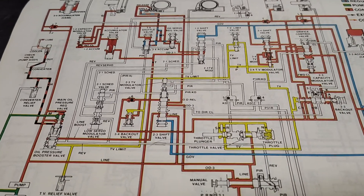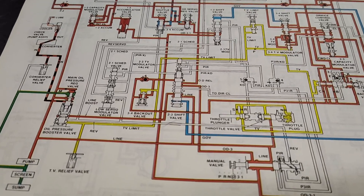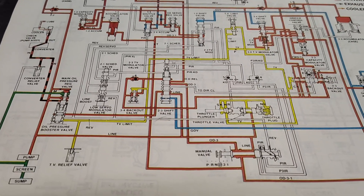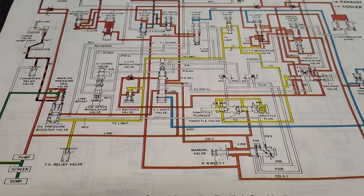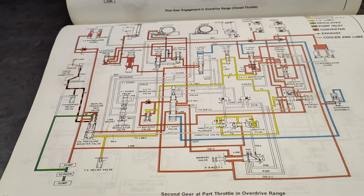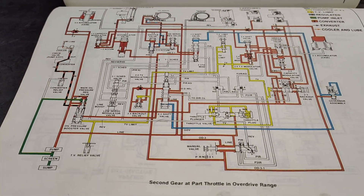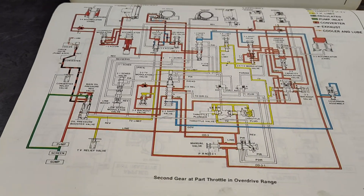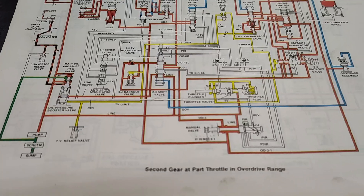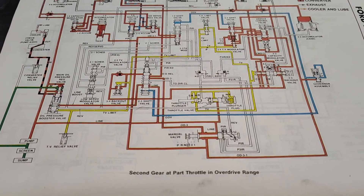What I like about it is if you sell somebody a unit, it's pretty unlikely they're going to screw up the TV pressure real bad and burn the thing up. But honestly, with my variable pressure valve body, it's kind of unlikely they'll burn it up anyway — I modify the way the pressure ramps up, so it's tough to burn it up. I don't do too many fixed pressure units. I tell people: if it's on the street, just do variable, you'll be fine. But if you're a trans shop and you're concerned about this, you've had issues with this — yeah, fixed pressure kind of covers you. It kind of lets you sleep at night.